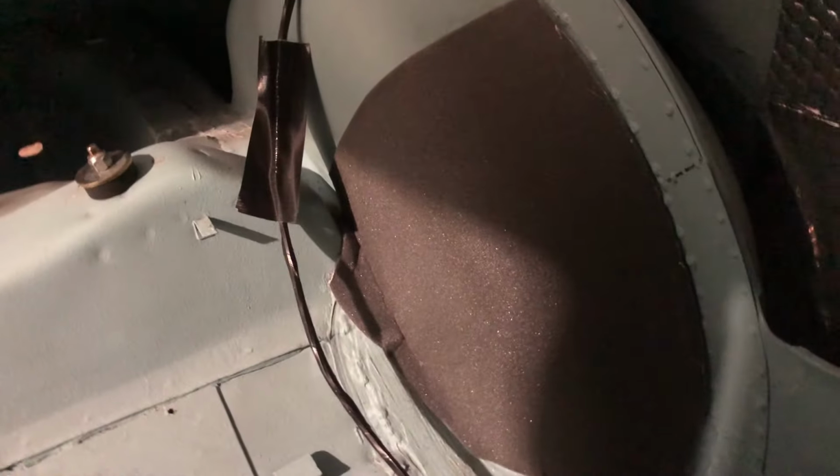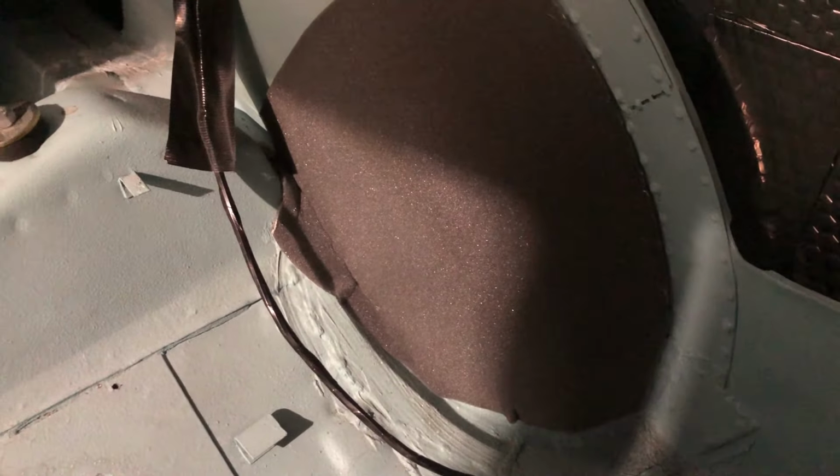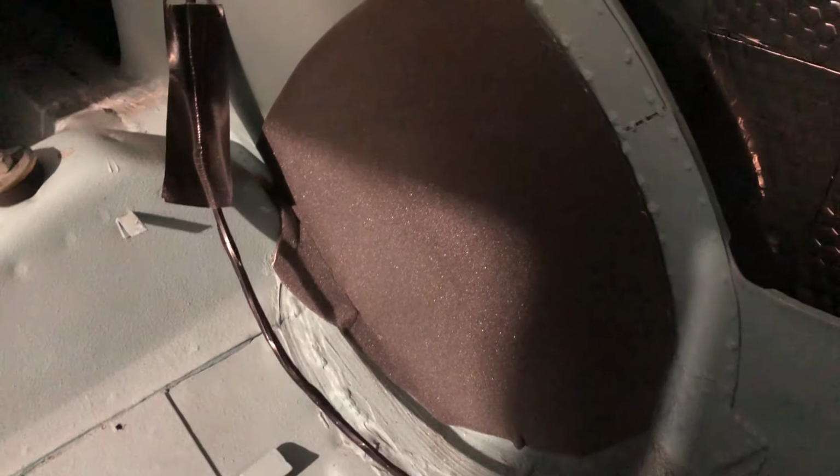So that's the foam backing stuck in place. You can see, pretty straightforward. Clean it up, a bit of... oh god, fumes are getting to me already. I just used a bit of panel wipe, clean up the tub. There's no grease or dust or anything on there, and then spray adhesive both the tub and the arch liner. Stick it on. I always try and stay away from this edge a bit, because what I found in the past, yeah, this is a nasty repair.